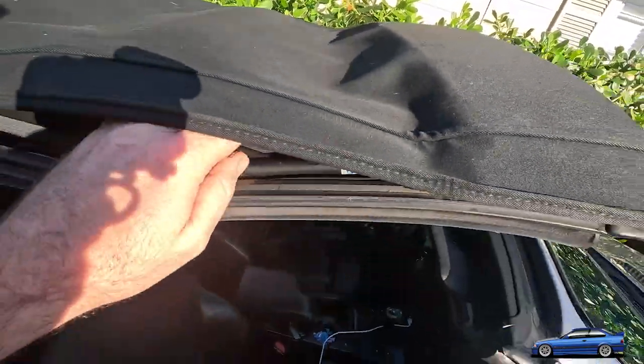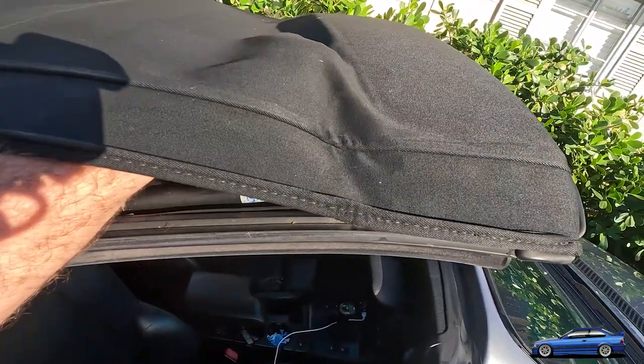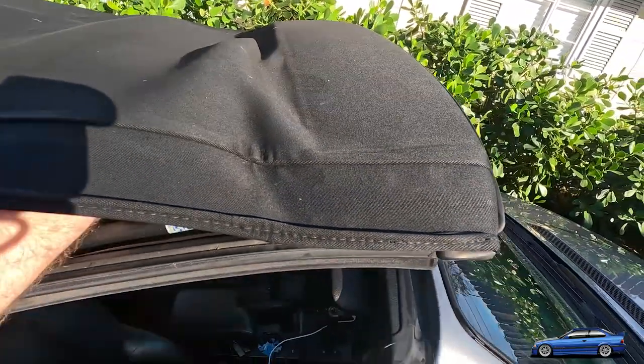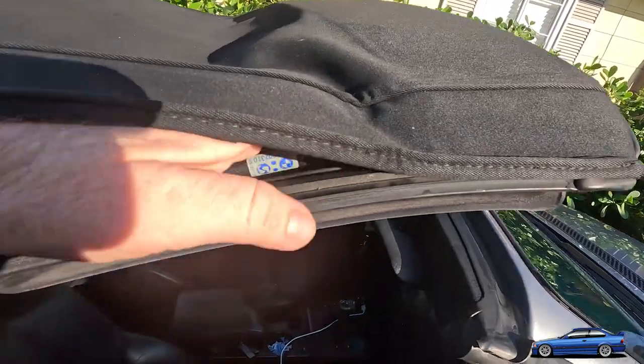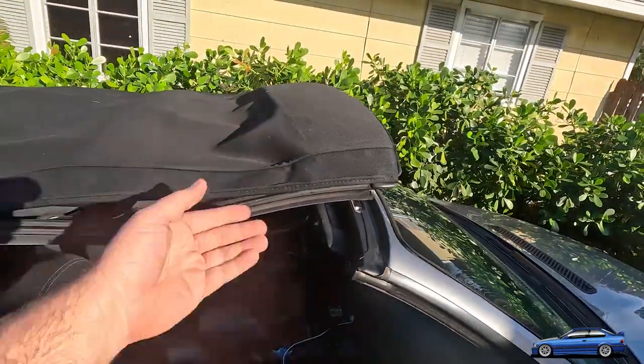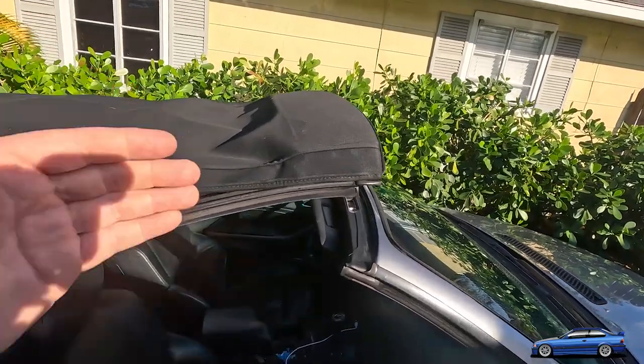So you'll stick your arm inside of here with a 1/4-inch ratchet and that T20, and there's screws inside of here. And they're on top of the insulation layer, and it's kind of hard to film that, but these you don't take out completely.